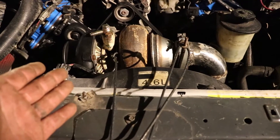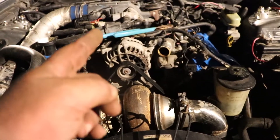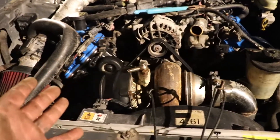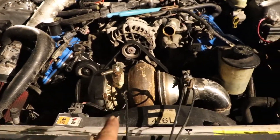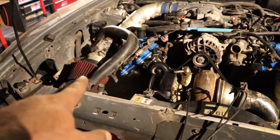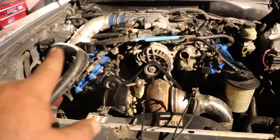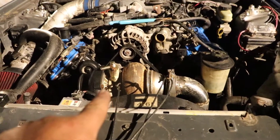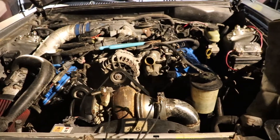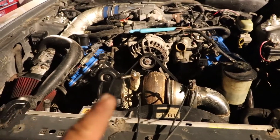If I make 350 horsepower with this setup before I forge the motor — I do have forged internals for the motor — I'll be happy. So we'll see. I'm gonna try this out, keep working on it, get it to spool and make boost. Got to get the intercooling piping next — that'll probably be next week. Route the intercooling pipe, finish the downpipe, get it to run super rich, and go from there. Still need injectors, fuel pump, stuff like that — but getting closer.